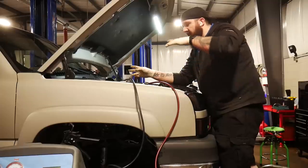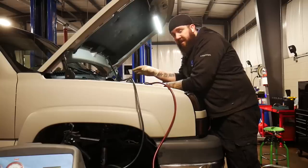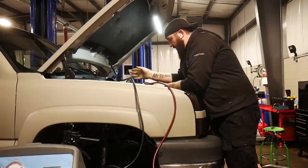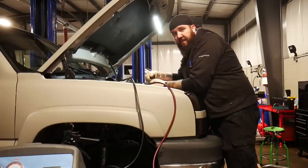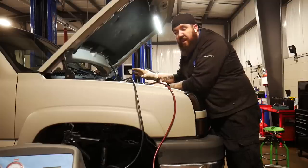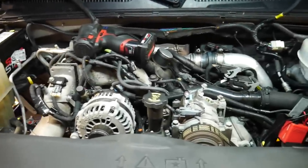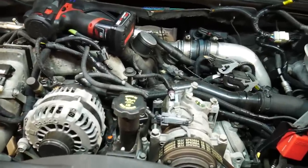We got our lines hooked up here to get our freon evacuated, so we're going to get that going with the machine. While we're up here on this side, we're going to be wanting to take our intercooler piping off — you can get to the top portion right here. And then we're going to start taking off the coolant hoses from the bottle, start getting our shroud and everything off from the upper side of our fan, and getting any wiring that seems to be hanging along with the body on this side also taking loose. We're kind of moving fast here — I'm just trying to do all this work like I'm used to being paid on flat rate.